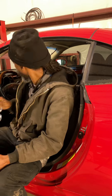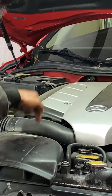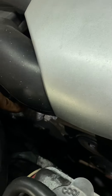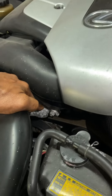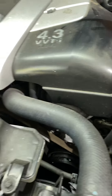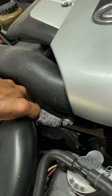It's the thermostat that's not working properly. It's easy enough to get to, and she's had this car for years and hasn't done it, so we're going with the thermostat. On the SC430 it's located right towards the top — right behind here. This is the upper radiator hose going down to the lower radiator hose. Before pulling any housing off, first thing: the engine has to be cool, not hot. This is cool. We still have coolant in here, so we'll need to drain some first.